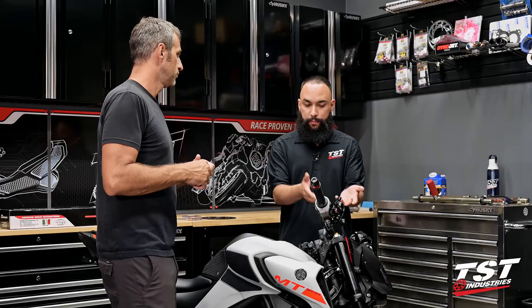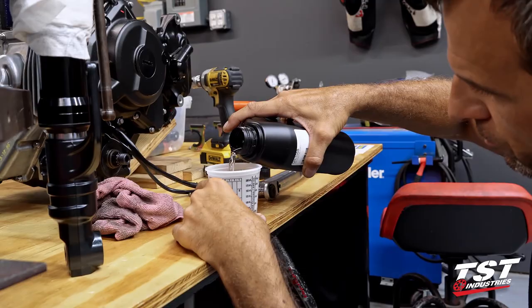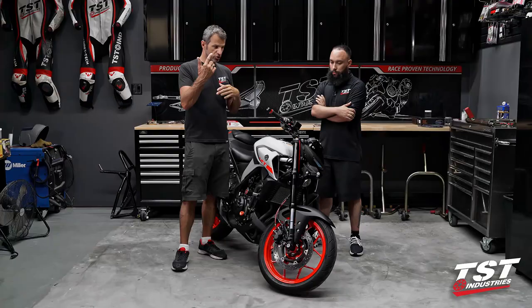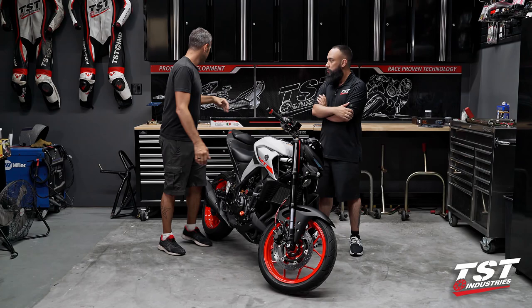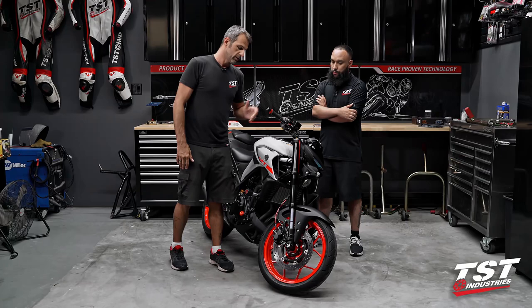After a little cleaning to make sure there's no debris inside, you fill it up and milk out the air from the cartridge, then do the oil level and close it back up. We didn't replace with the same fluid - we went with 5-weight oil, which is what's recommended by Andreani. We used Ohlins oil and did the level based on what it says on the box: 110mm. Done.